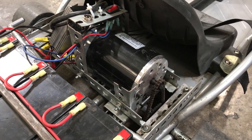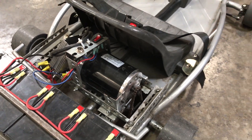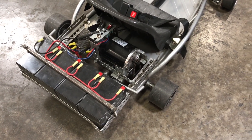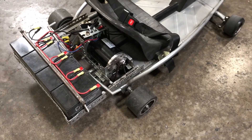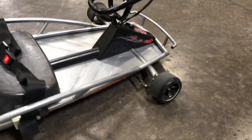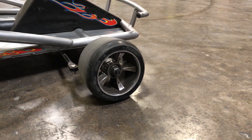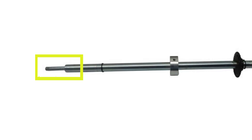Pushing 48 volts to a 36-volt motor, we were able to increase our RPM substantially. But in doing so, you're going to lose some low-end torque, which is not a big deal when you're using the stock rubber tires that come with the Razor Ground Force. But we started breaking axles because the Razor Ground Force comes with an axle that only has one drive wheel on the right. The left is actually a smaller shaft used for a bearing setup within the wheel, so it just spins and doesn't cause traction issues with two wheels spinning at once.